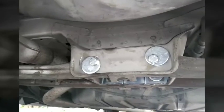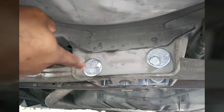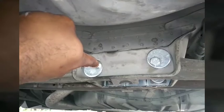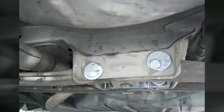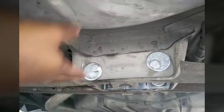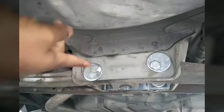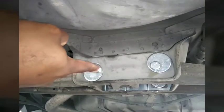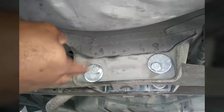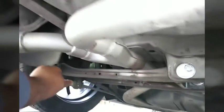What you have to do to make this work is unbolt the factory bolt seats right here, which causes the arms to drop. Pull them out of the way and use the template included in the kit. You put a drill right in the middle of the factory hole and elongate it a quarter of an inch each way on both sides. Once you put the trailing arms back on, you put the backing plate — one on that side, one on the inside on this side. With the bolts reinstalled, you can loosen and turn them. You see how the bolts are off-center? When you turn it, it moves along the elongated holes and works on the trailing arms hooked to the suspension.